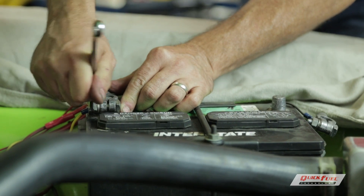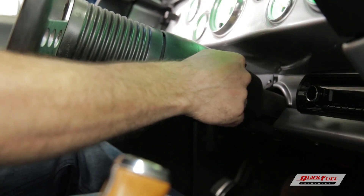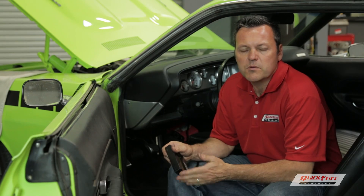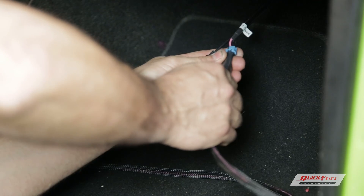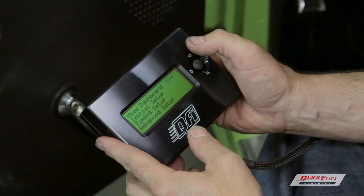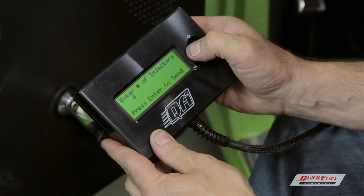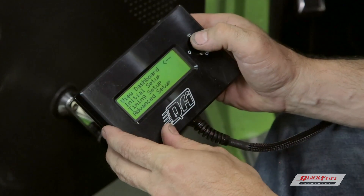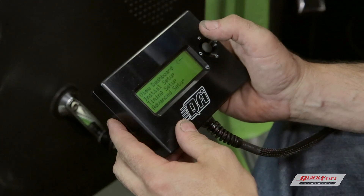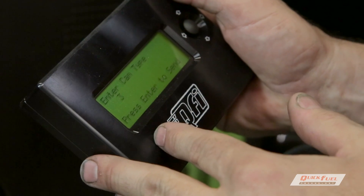A few final touches and we'll be ready to start programming. It is very important to connect the positive on the battery first, then connect the ground to the battery. At this point, you could turn the key to the on position, check the fuel pump for proper operation, and check for fuel leaks. Do not start the engine at this time — first we must program the ECU. Now we're ready to plug in the handheld controller to the main harness. The wires are labeled, they can only go in one way, so it makes the installation a snap. The QFI controller allows you to enter the parameters necessary for the ECU to properly run the vehicle. Go to the initial setup: number of cylinders is eight, preset from the controller; number of injectors are four; injector size of the system are 66-pound injectors. You'll need to know your engine specs including the cubic inches, cam type, distributor type, etc. This will allow you to set up the engine timing, along with some advanced settings such as fan control, fuel pump parameters, cranking fuel settings, and more.